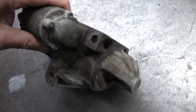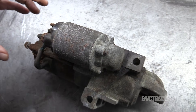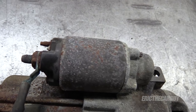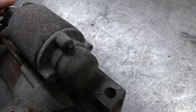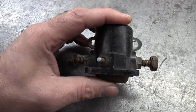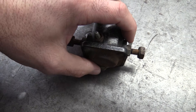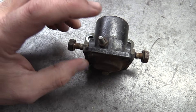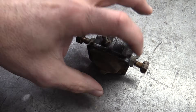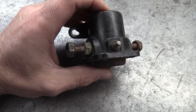One last little tip: if you wanted to take this starter apart, you would remove these fasteners and pull it apart this way. Different solenoid styles have different ways of coming apart, but that's how this one comes apart. A starter solenoid is basically a glorified relay that handles a lot of amps. We've got a battery input coming into this side, and this is the cable that leads down to the starter. This is what activates the plunger that comes down and makes the connection between these two posts on the inside. It's frightfully simplistic in how it works.